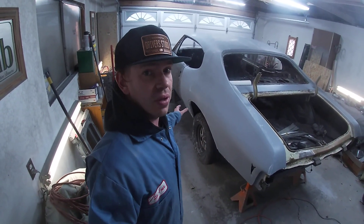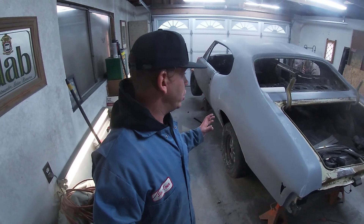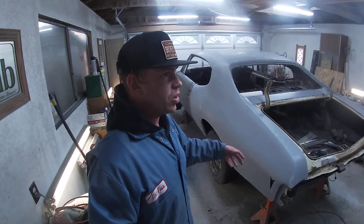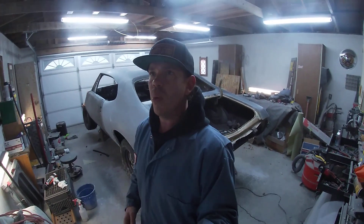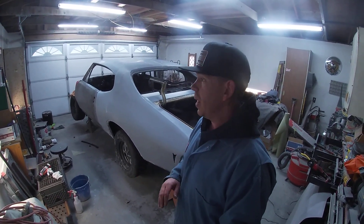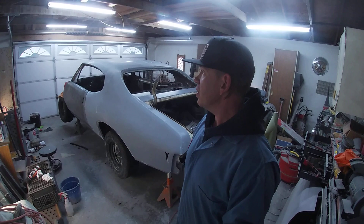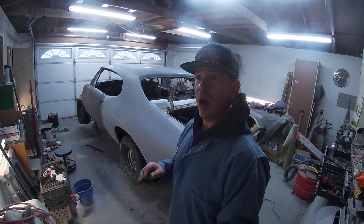The doors are all lined up really well and I'm really happy with that. I'm going to be spraying the car with the interior masked off, and I will be jamming the car while spraying the back portion. The deck lid, fenders, hood, gauge assembly, and rear spoiler will all be sprayed off the car. We were going to run color-matched mirrors but decided against it — instead we're doing chrome mirrors.